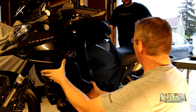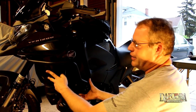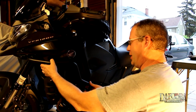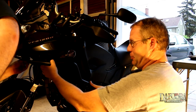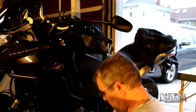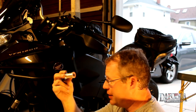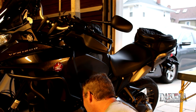Look at the front — this one went right through! That one actually fits. So by some miracle we got it bolted up and this side actually lined up. We cleaned up the threads and started bolting it on. Note that on the left hand side of the bike when you're sitting on it, it uses longer bolts. The right hand side uses the shorter bolts. There are also spacers on the front on both sides which go between the engine and the frame. So let's get that bolt in.